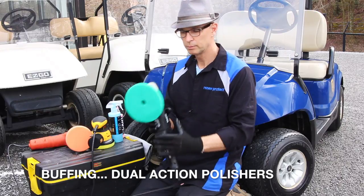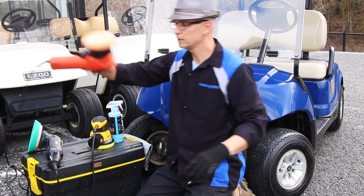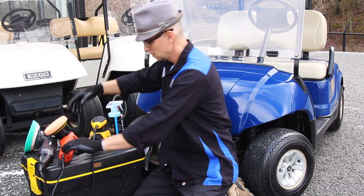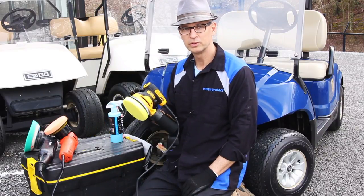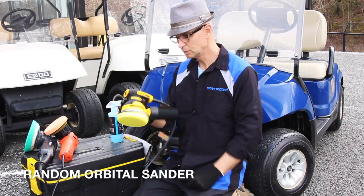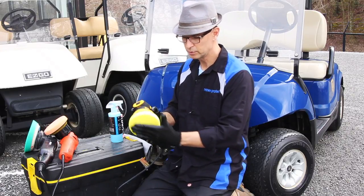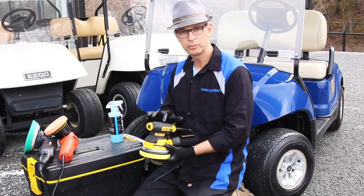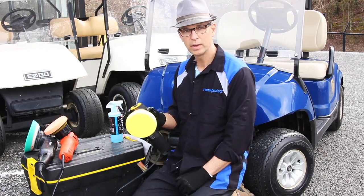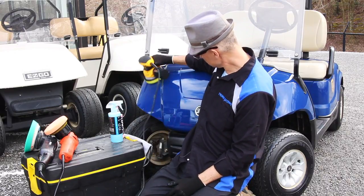This is quite a good machine — very strong motor, professional level buffing machine — a little overkill for our job on a little golf cart. My preference for golf cart detailing, for buffing and resurfacing the gel coat body and the acrylic windscreens, is dual action — you've got oscillation and you also have rotation. This little guy with a 2.5 to 3 amp motor and a speed control dial will do the job quite well with a golf cart, and considering the size and the size of the pad, it's easy to work into the small areas.